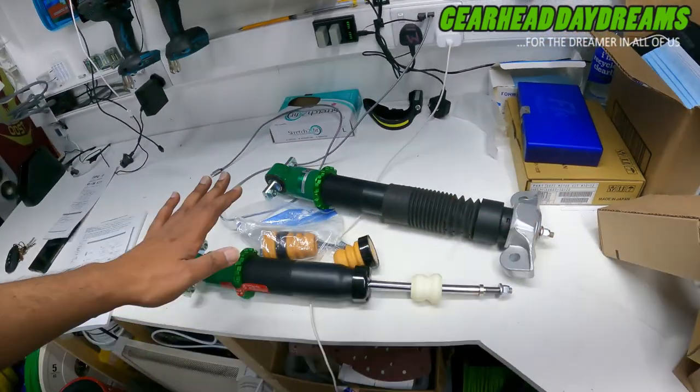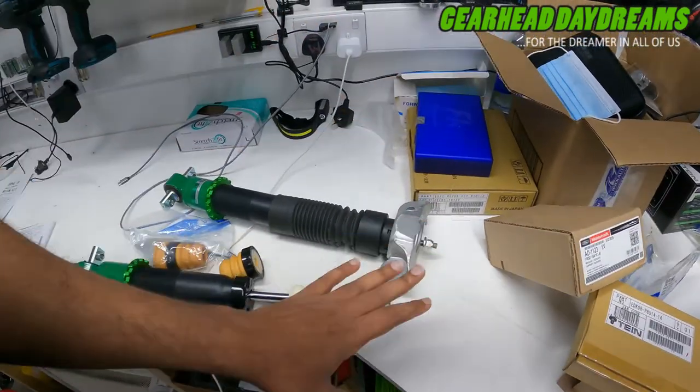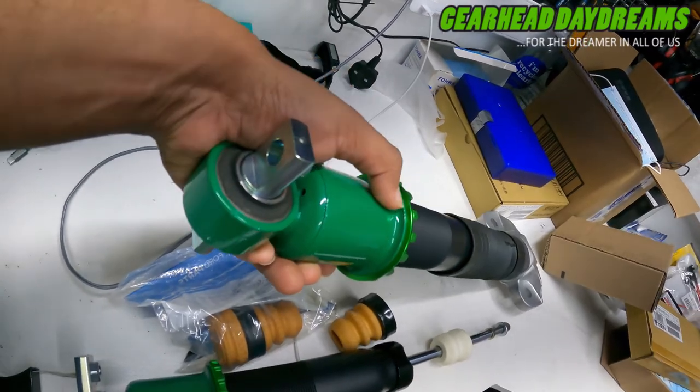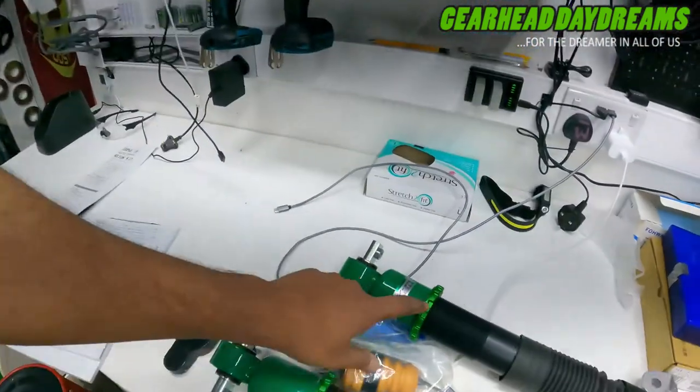The problem I've run into going forward is - I'm waiting for my crow's feet so I can torque the nut. Once that's torqued we're good, and installing the EDFC is not an issue. The real problem I have is this lip here. If you've done modifications to your car, particularly on the rear - I have the aftermarket DSS half shafts which are thicker - and if you already have something like the Ford Racing track performance suspension like I do, you'll realize the clearance between the CV boots and the shock is very, very tight. We're talking less than a quarter of an inch.